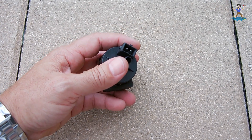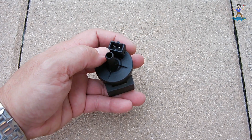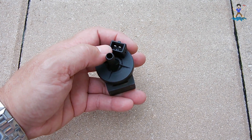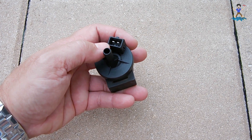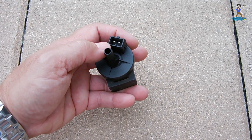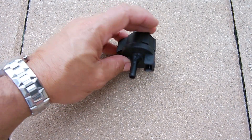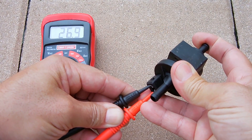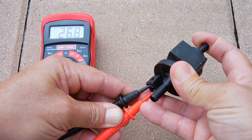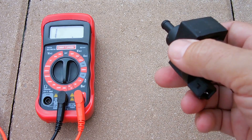When you test this, we're going to be applying a vacuum on the intake manifold end. But before that, I want to look at the connector — we're going to do a resistance measurement. You want to make sure this is not an open circuit. Set your digital multimeter to a low ohms range; around 200 should be fine. Probe the two pins — you should get a low reading. This one is right around 27 ohms.